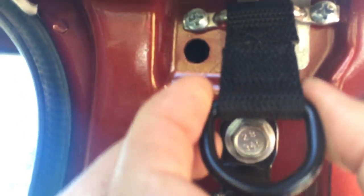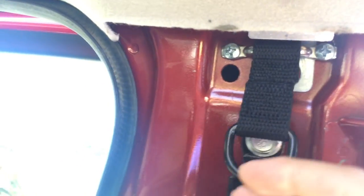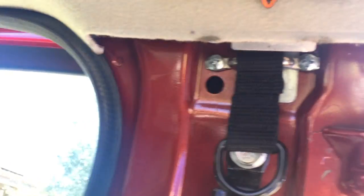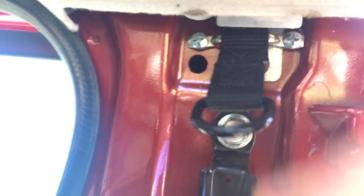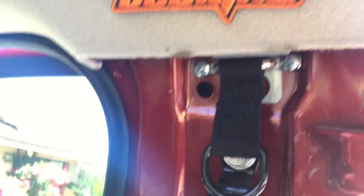This has been attached up here right above this upper B-pillar mounting hole. You'll drill two 5/32" holes and you're gonna need to use the two little screws supplied — they're kind of self-tappers, so you just drill those holes and then those will tap in. It's right above this clip, and then when the A-pillar goes on, this just sits up like that, and that's gonna be your connection point for the front area of the net.